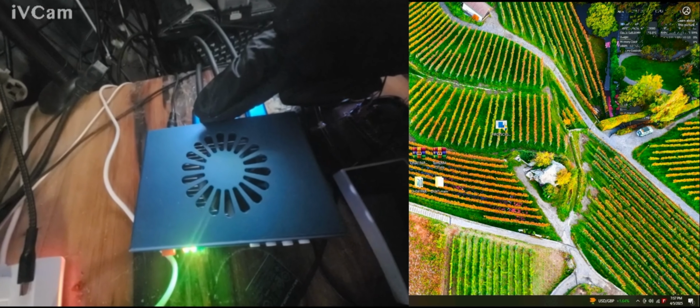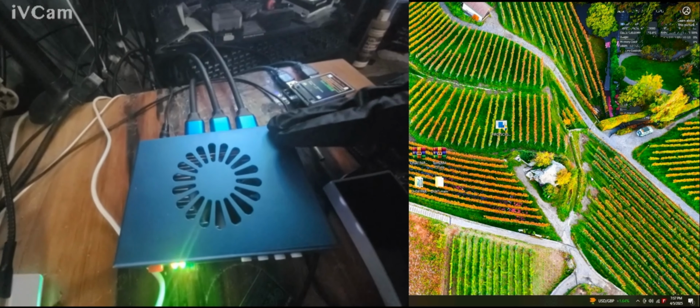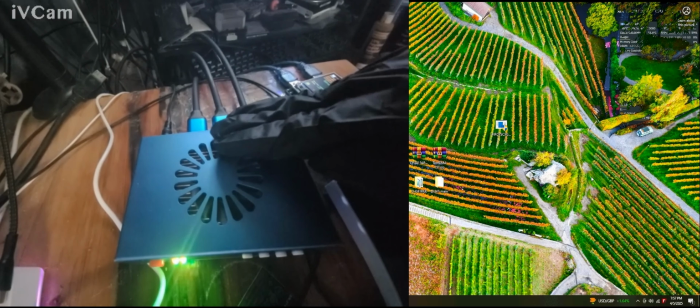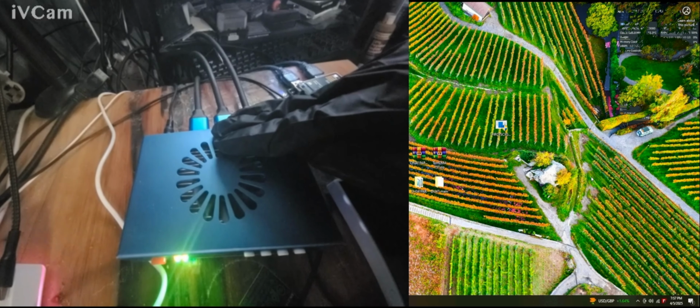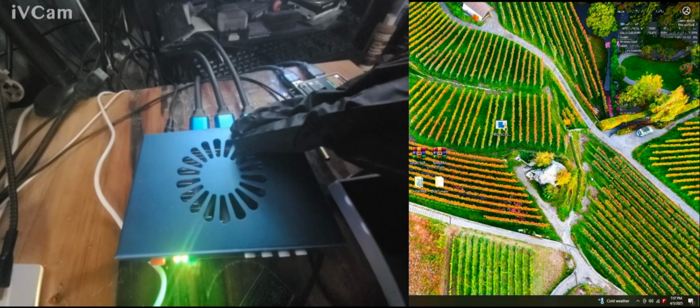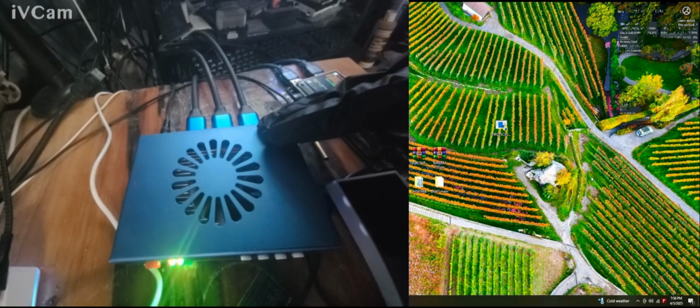Then we move on to the HDMI ports. If you have a DisplayPort fuser, all of them but the last port will be the same. The first one is for your second computer. It's the input from the GPU. The middle one is for your main computer from your GPU. Lastly is the display output. This might be DisplayPort if you have a different Dichen fuser.